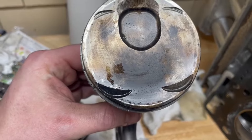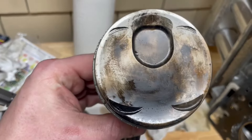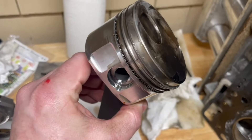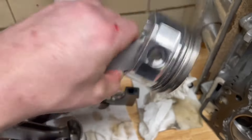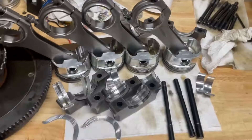We're not going to go hyper aggressive with the piston machining. We might match where the divot is for the DI system but run it down towards the bottom of the piston a little more — just take that area out. We're going to stay away from taking material from the sides because we don't want to make the top of the piston weaker by any means given the pressures it's seeing.